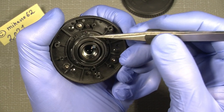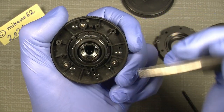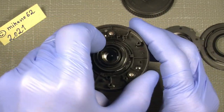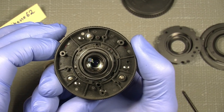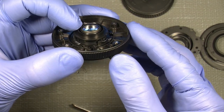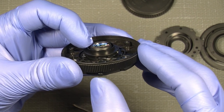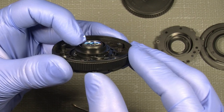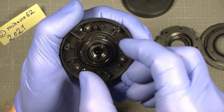Open the lens with the front lever here and look what will happen — the lens will move. The lens is open and at infinity, and if it moves it will go to close focus. So it can lift the lens assembly out. Be careful to not just put it straight on your desk — it's very exposed, the lens here. Also the bottom of the lens assembly is very exposed, so if you put it on a metal surface, use a rubber cone and put it straight there.